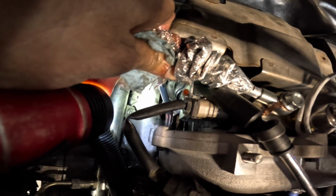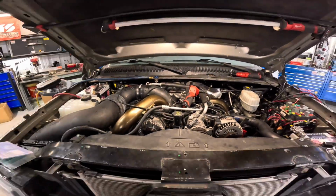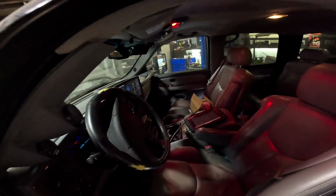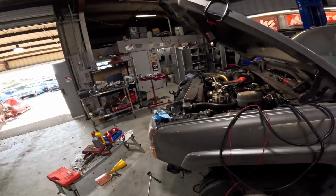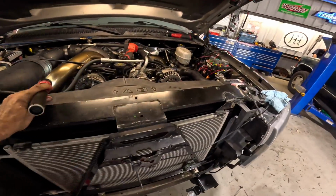Yeah, take a look. Turbo drain lines leaking everywhere. I gotta pull the turbo out and put a drain line in it. That drain line's leaking. Bad. Comedies and tragedies. Not okay. Oh, what a disappointment. Yeah, it's dumping engine oil out everywhere off the top of that.